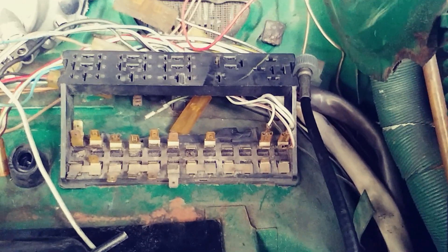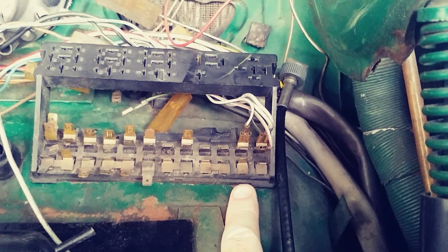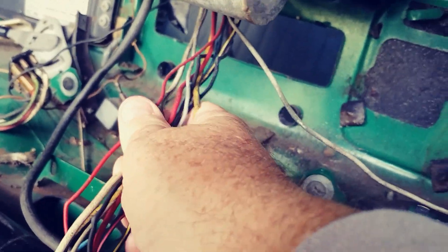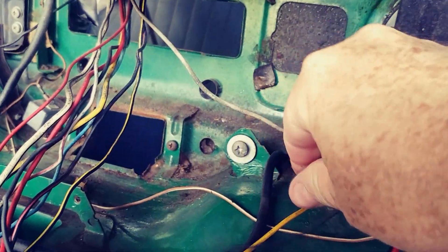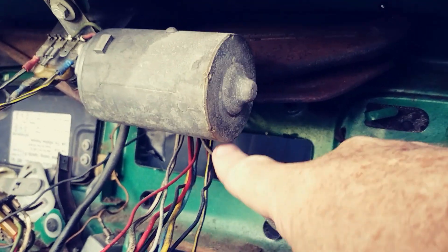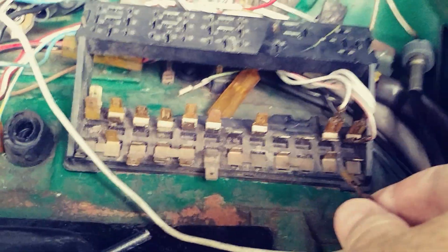Back up front, it turns out there is one more wire needed to complete this fuse. Just a quick reminder, we are working on the second fuse, which is wiring the left rear taillight. To complete this fuse we need the wire that comes off the light switch — it's the solid gray wire, right here, which comes off the light switch behind the wiper motor. It goes into the front and just plugs right in. And that completes fuse number two of the 1972 Super Beetle.